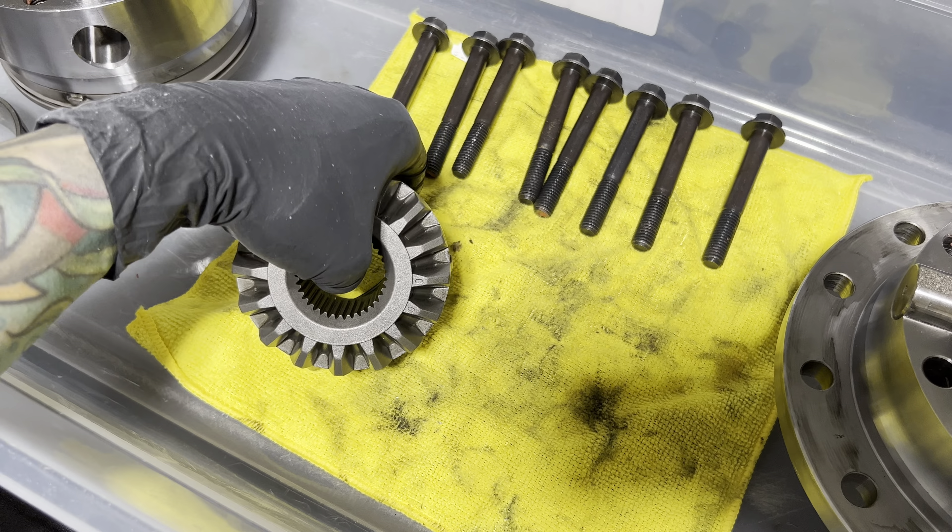This side doesn't come apart, or at least it's not necessary for what I'm doing. It seems like it's some type of press or machine finish. I don't see any issue with any of these forged gears — all that looks pretty good. No pin issues, no damage there. I didn't have any damage to my ring and pinion, so that was good. The only issue I found was the teeth being messed up. I've been told that one of the issues you have to be really careful about with these lockers is making sure they have enough voltage. I did check the voltage, and it was actually showing a little high — around 14 volts at the plug. So that didn't seem to be my issue.